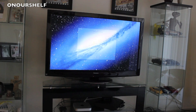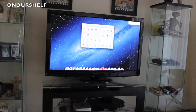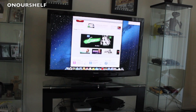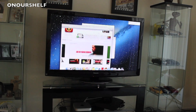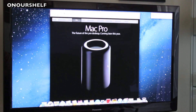Here is the mega setup itself — a Mac Mini hooked up to a 50-inch Panasonic Plasma GT Series TV. It looks pretty good, though you may have to calibrate it a little bit. I apologize — my camera wasn't completely focused, so it looks a lot clearer in person than the camera picked up. When you first turn it on, go into Settings, then the Display menu, and adjust the scale because otherwise the top menu bar won't show. But you can adjust that and get it to show.